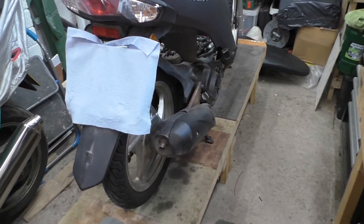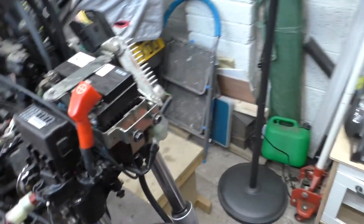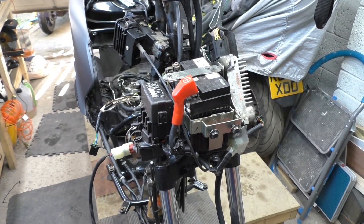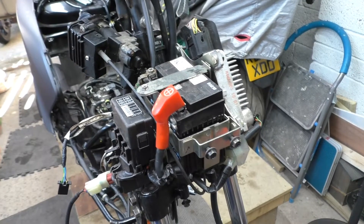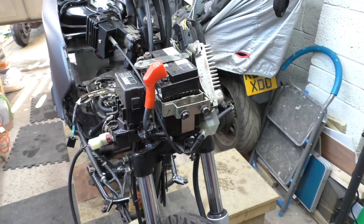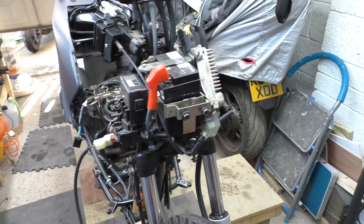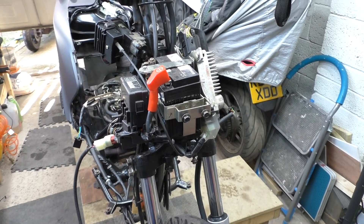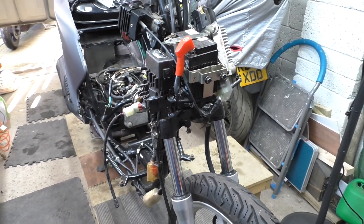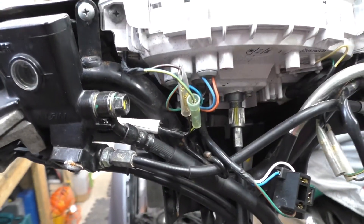The Vision's back in, it's on the bench where we left off last time. We just put everything on the front back in. I've got a new battery on order because this one isn't holding a great voltage - it's the original battery. At some point in lockdown it went down to about seven volts. We managed to revive it but it's only about 12.3V after starting - not great. New battery ordered from Toner Batteries and Brakes. No leaks, everything looking great from last time.